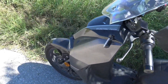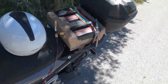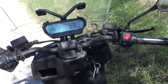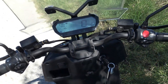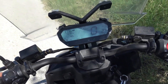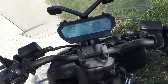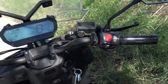It rides beautifully. The only thing is I need to do something about its BMS — it does not accept regenerative braking. So if you use the brake for 6 or more seconds you will get a code 93, and somehow it would lock. Still, the rest of the batteries will be charged by the controller. That's a problem. The fault code disappears when you open the throttle.